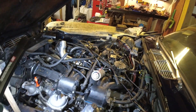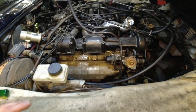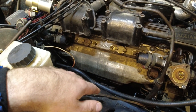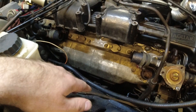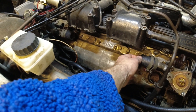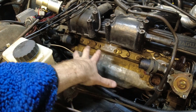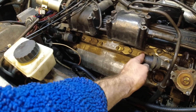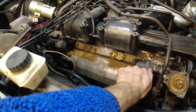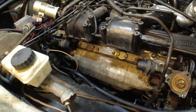I'm going to clean up the other side now, replace the fuel line on the carbs, and then show you guys getting it all on there with these hoses. This is all prepared now, ready to get the carbs on. I cleaned up this area a bit - nothing fancy, I just don't like working on dirty engines. It takes two minutes and just looks nicer. These hoses have been slid on as far as they'll go - that should be enough to get the carbs in place. I'll lubricate them with some washing up liquid - it's apple scented so it smells really good - that will allow me to slide these in since I need to slide them back once it's all together. I have the bolts laid out: shorter ones in the front, longer ones in the back.